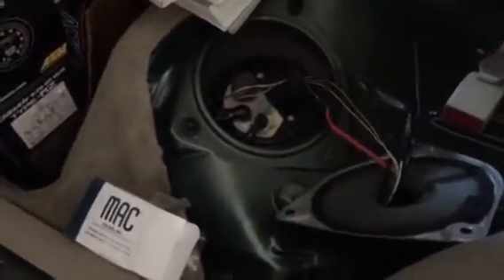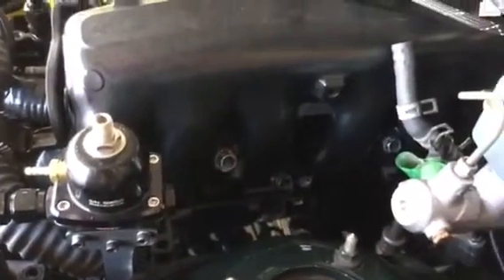I'm also hooking up my return fuel line in this video. I already got it hooked up here from a previous video, but I'm going to run my line now and hook it up to my fuel pressure regulator. It comes down here — this is the line, and there's a little panel here that I'm going to slide it through, which goes all the way down. There was already a hole here — not an intentional cut, but something already made it — so I'm going to go through there and slide it up to the top. I've got a lot of length still, so I'm going to make a cut for my fitment down under.